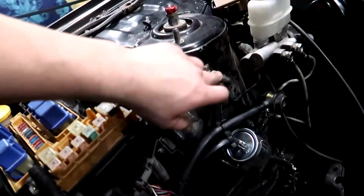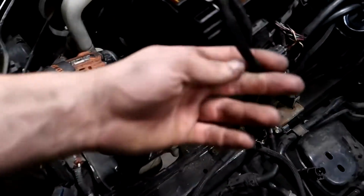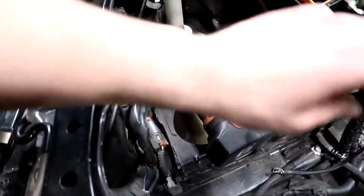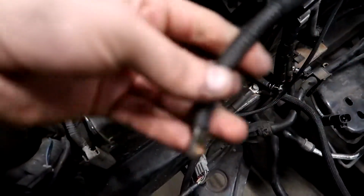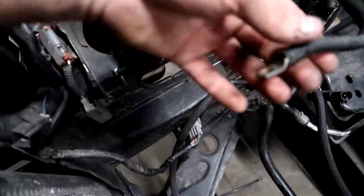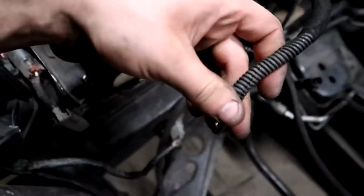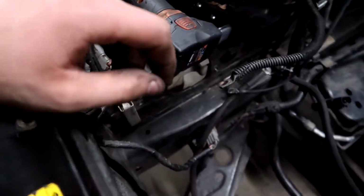We've got these 2 lines here for the fuel pump wiring, so that'll be running to our positive, and there'll be some slight adjustments compared to the standard stuff. So that mounts up to the positive, and usually, for those of you who know, the red and white will connect up to a little pin on the positive, where this one will just have to go to a nut and bolt. So that'll be no dramas.